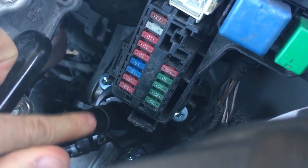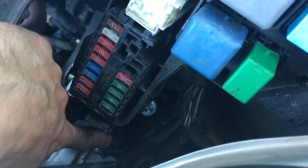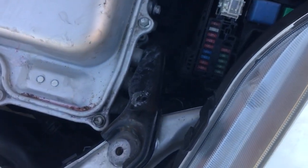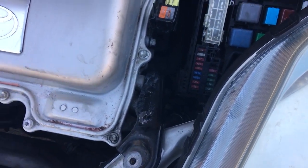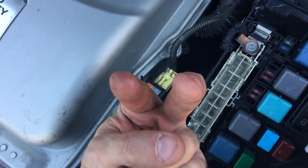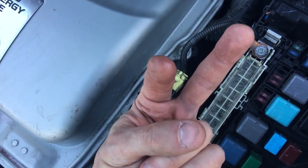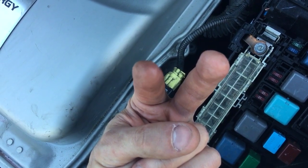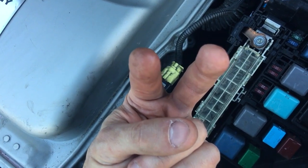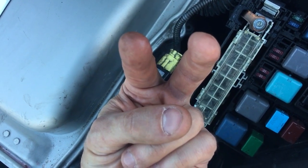How I truly tested this: back to the plug — when you disconnect this plug and take it out, there will be two leads because it's an electric water pump. On the right side is the positive lead. I have the positive lead with my middle finger and the negative lead with my index finger. Your red is the positive lead and your black is the negative lead. If you connect a 12-volt battery to it, your pump will operate. If it does not operate, then you have a bad pump.